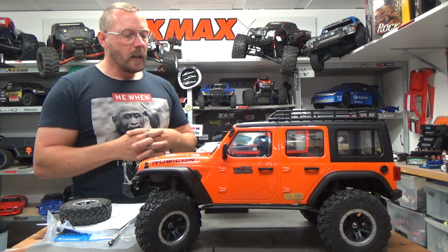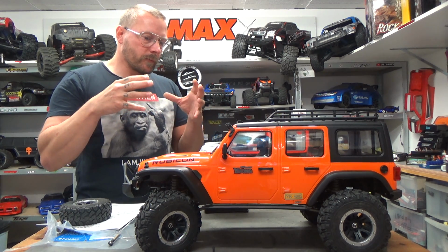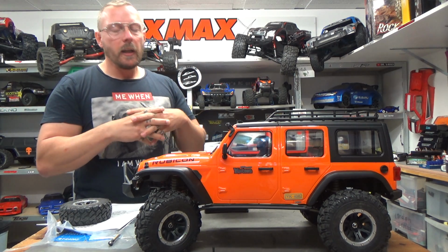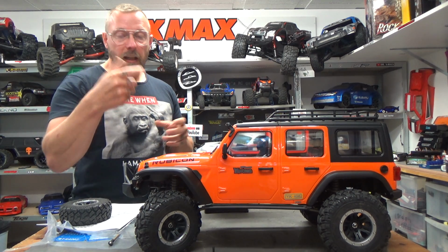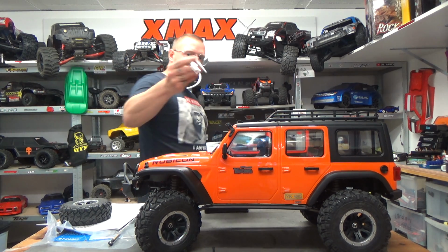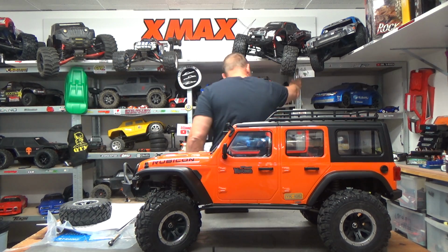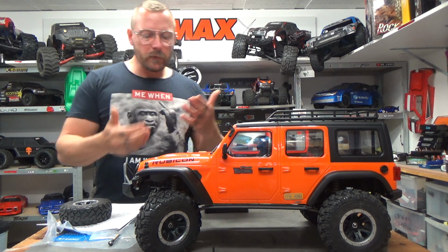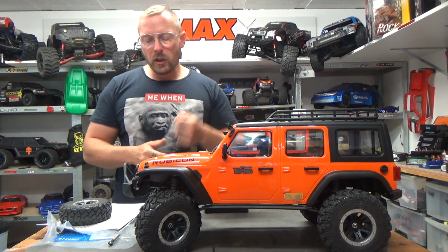And we do the same to the panhard bars if you have one. Not every car has it, but the cars that have it, we put it away because this bar can stop the angle of fall down from the axle. You can do it with a body pin, something like that. This is what we use to unlock the sway bars and the panhard bars on real 4x4s. So you can go off-road, big off-road with really heavy suspension travel. And when you're back on the road, you switch it on again.